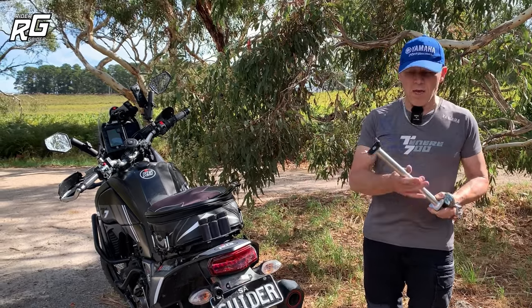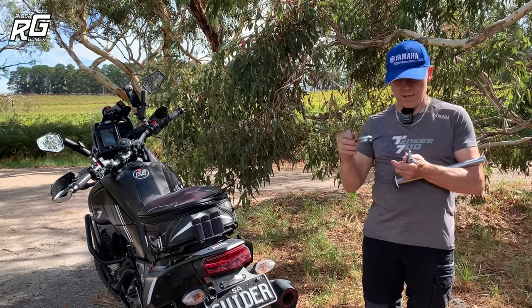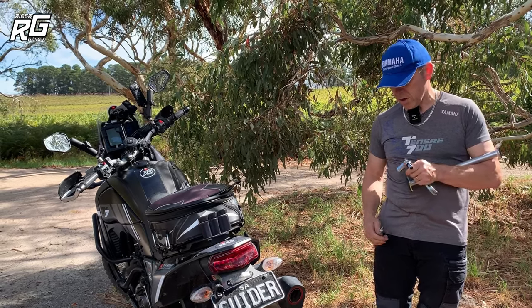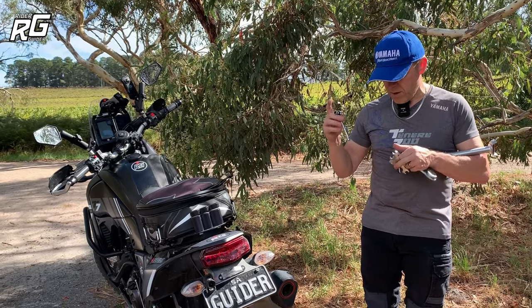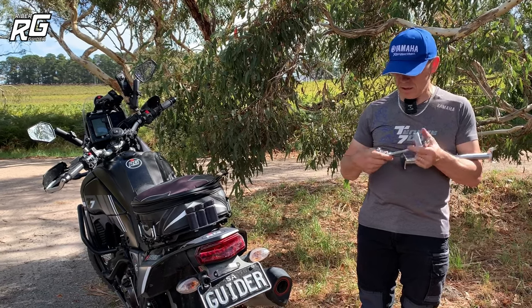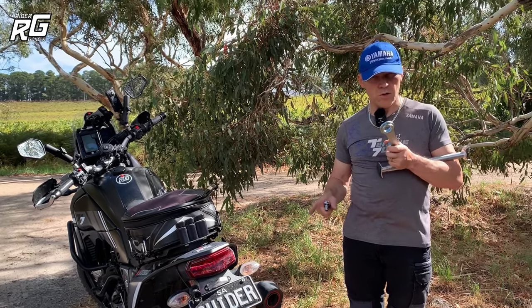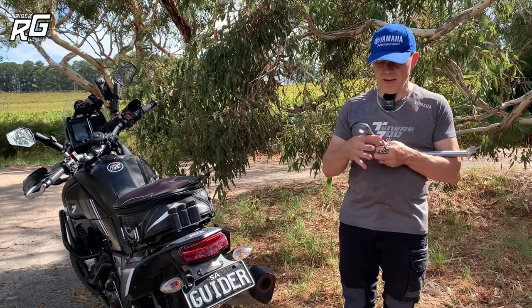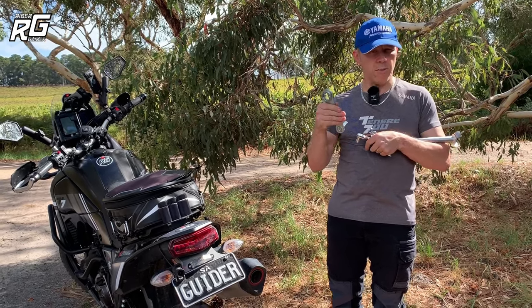The challenge was to have a go at doing it out on a trail in the real world. We're going to do a remove and refit using the trail stand. I've brought the tools, the trail stand itself, the chain adjusting spanners, and a 10mm socket and ratchet because I've got to remove the ABS sensor. We'll need a socket or spanner for loosening the nut on the back wheel, which we'll do before we actually lift the rear.